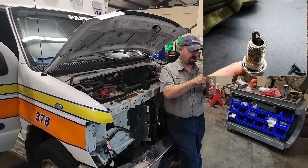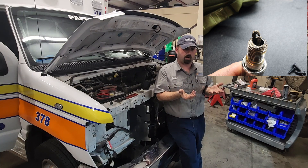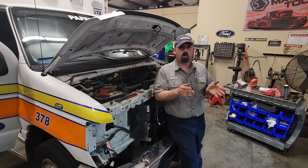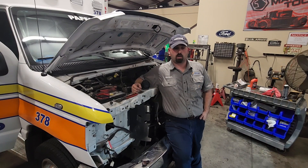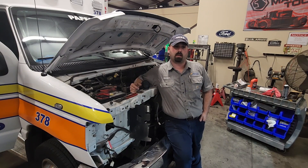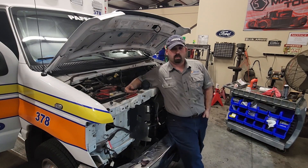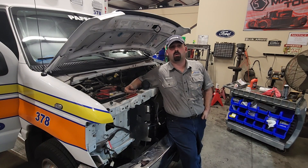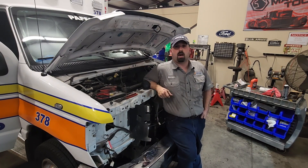The spark plug is intact — the electrode and the strap are still there, but the porcelain's gone, probably turned to powder. I don't see the porcelain doing damage like that; it'd just get chunked into powder and blown out. We'll see if it did any damage to the catalytic converter — hopefully it's just sitting right there in front of it. On newer engines when they misfire, they turn off the fuel injector so it's not pouring raw fuel into the catalytic converter and burning it up. We'll do a tear down video on this engine — my money is on a piece of dropped valve right into the combustion chamber. Thanks for watching, like, comment, subscribe, and we'll see you on the next one.